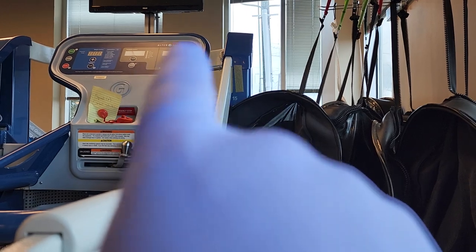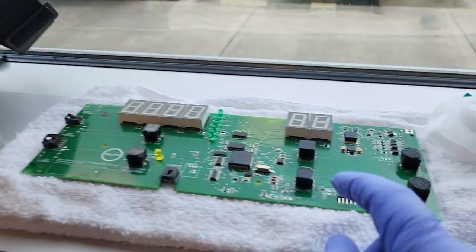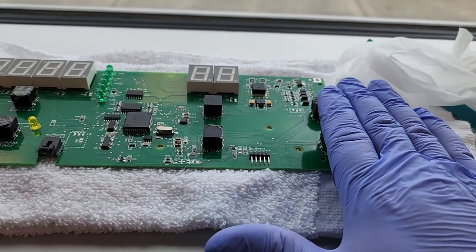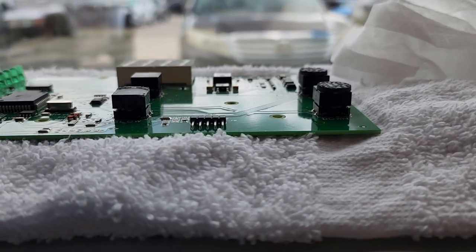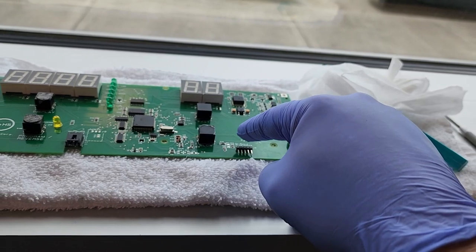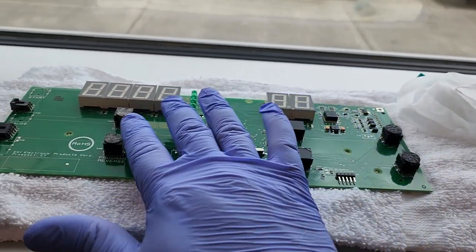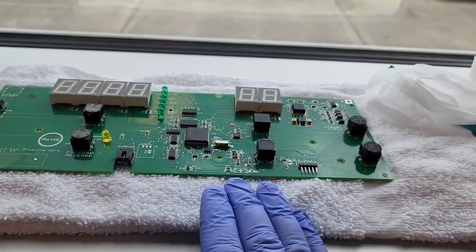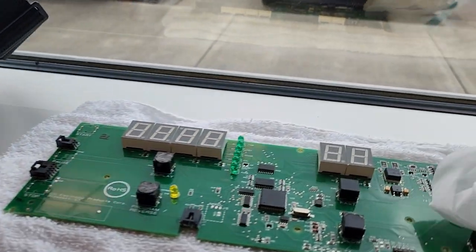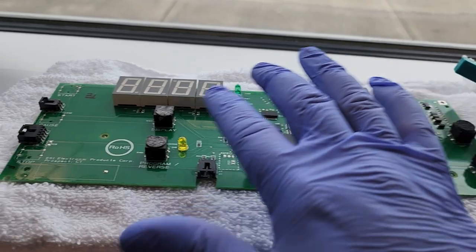The staff said they replaced the decal a couple of times. The problem is, if the decal is designed for a certain height and you're getting a different height, you can see the difference. You're stretching the decal and pressing it in further than what it was designed for. That's why we have to clean the board right here — I'm using WD-40 contact cleaner and a nylon brush to clean these surfaces really well.